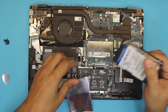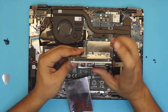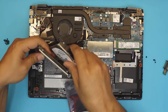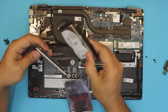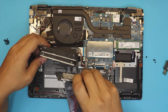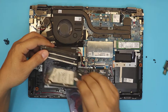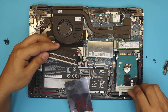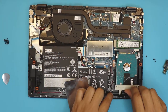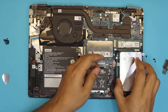By the way, this laptop only supports slim hard drives — the ones I'm showing are thicker. If you want to buy a laptop hard drive, you have to buy the super slim ones. They come in three different sizes: this is a one terabyte Seagate which is extra thick, medium thickness, and slim. This laptop only supports the small low-profile size, so you want to grab your small profile drive and it will just fit in there perfectly.